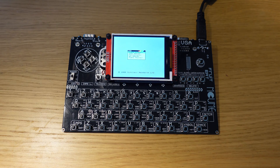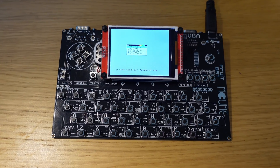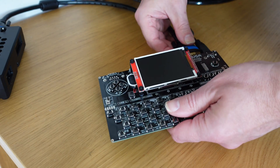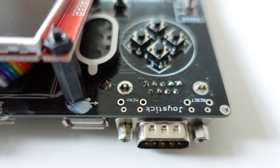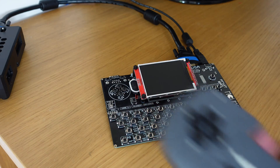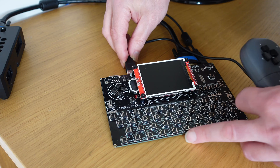But some might say that they want to actually use it rather than just admire it. For regular use you'll want to attach a big screen and a gamepad, which you can do. There are a few gotchas though. For the joystick, I found that the Atari-style joystick port didn't seem to work too well, and it was better to use a basic USB controller like my Retro Games one. That seemed to emulate a Kempston joystick OK.